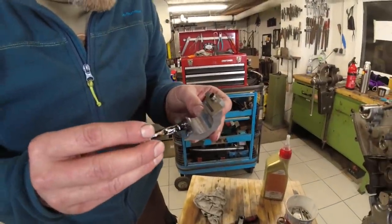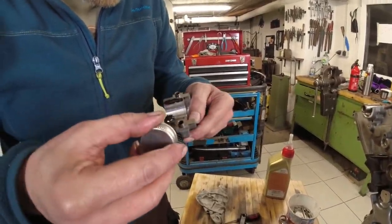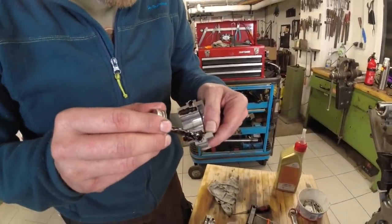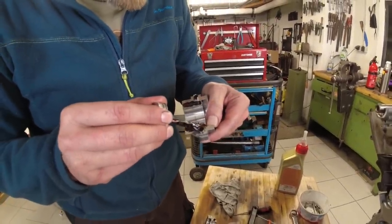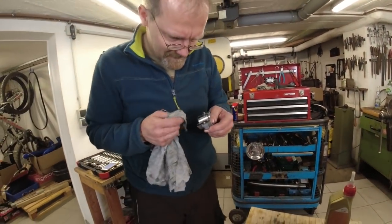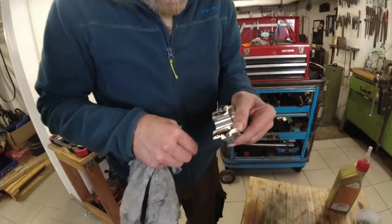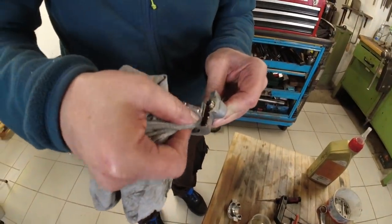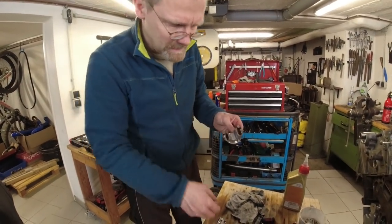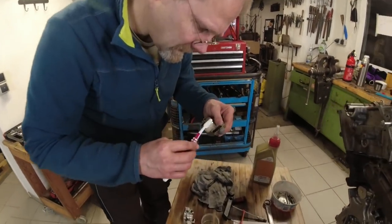They specify a 2 millimeter to 3 millimeter bead. I think this is good. I don't think so. This groove is there, so it accepts the excess bead. So I did it actually all wrong. Yeah. This has got to be behind the bead. Oh, like this, yeah. And now when I push it on, it pushes the excess into this groove so that it doesn't go onto the camshaft.